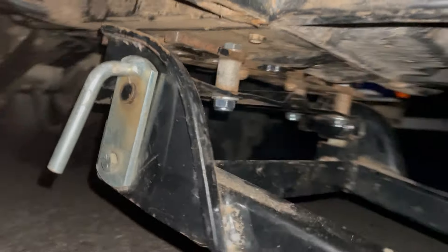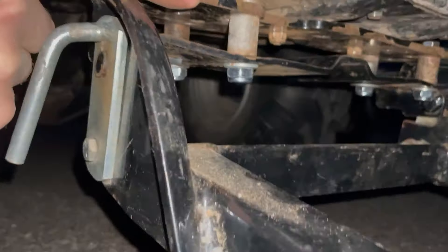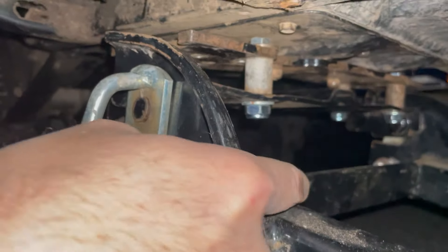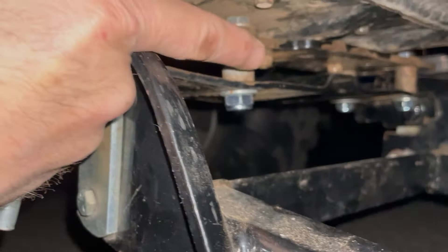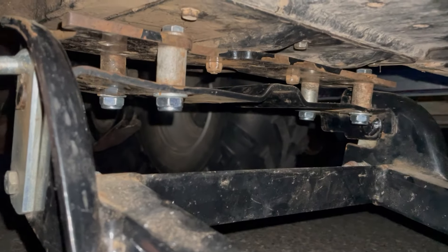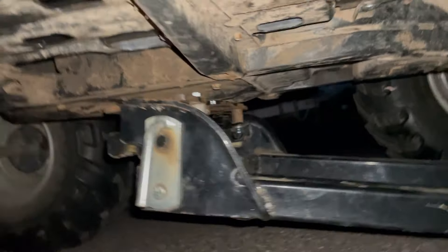My little design had to get it down low enough to get this to be below this frame. So I took the plate that would normally go on the upper, above this frame, and then the lower plate would pinch between the two — and those would be the spacers. So there are actually two plates. That should work pretty good. That's just mounted to the skid plate with some hardened steel bolts.